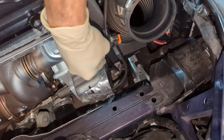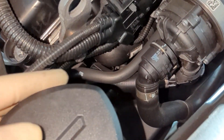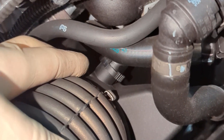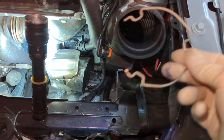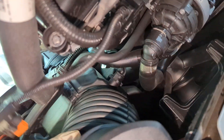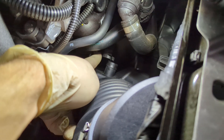Next, there is a wire clip along the side of the clean air pipe — go ahead and get that loose and slide it out of your way. Next, focus on the PCV pipe on the other side of the clean air pipe. To start, remove the clamp that holds the clean air pipe to the turbo. There are two raised points on the bottom side of the turbo pipe that you can get a screwdriver under to loosen that clamp. Once that's off, pull the clean air pipe away from the turbo slightly — don't go too far, you don't want to break that PCV line, but it will give you a little more room. Squeeze the sides of that PCV connection and then pull it off to the side.